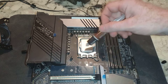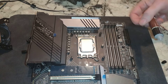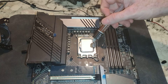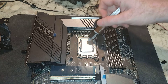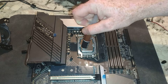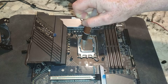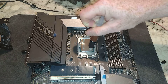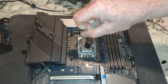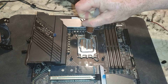Obviously with a locked CPU that's got a round bottom on the stock cooler, that is potentially the best way to do those, because it doesn't make contact with the whole CPU where this thing is going to make contact. And of course there are certain areas that get hotter than others. There are all kinds of ways one can do this, and you will see videos out there that talk about the best way to do it. What I like to do is make this third line usually thicker, with maybe a bigger blob in the middle.